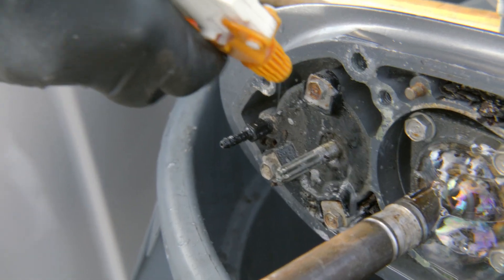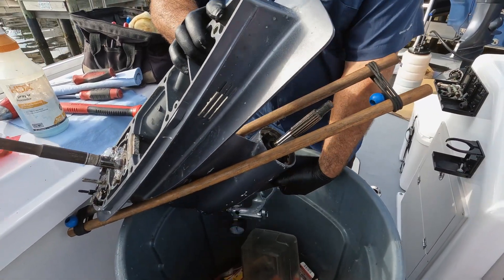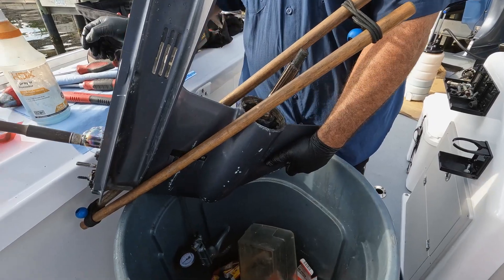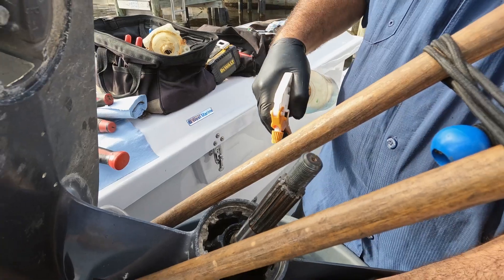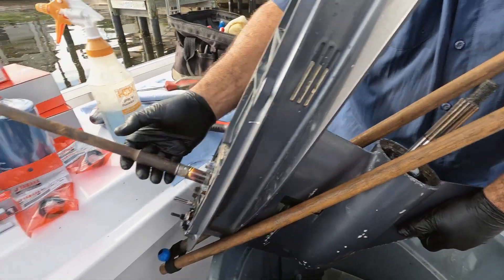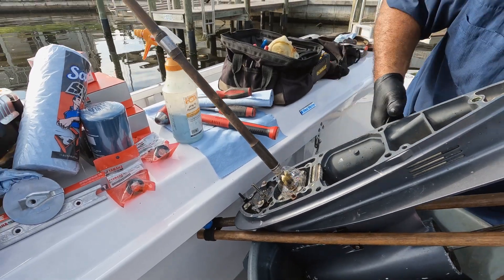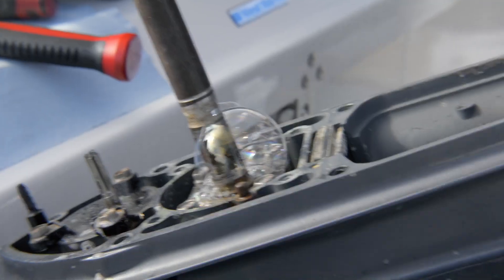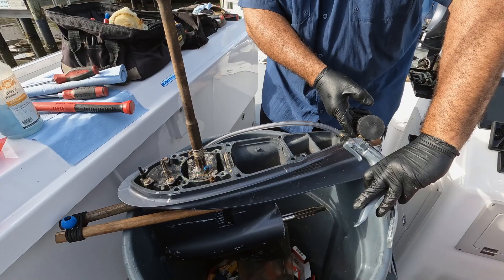The shift shaft seal is holding but it's going down pretty quick, and the drive shaft seal — let me come around here and hit that water down. I'm filling it up and we don't see any bubbles creating like that other one, just a little suds from spraying it but no bubbles, so that's good. Look at those bubbles coming up — let's hold this right here.